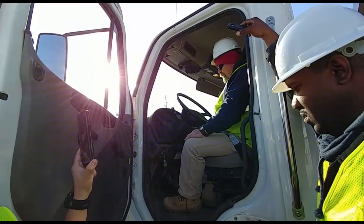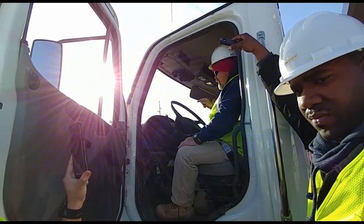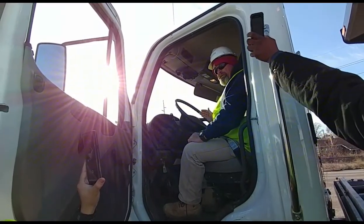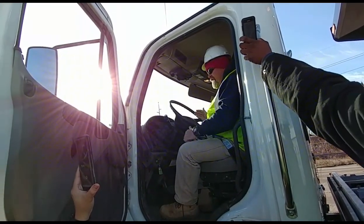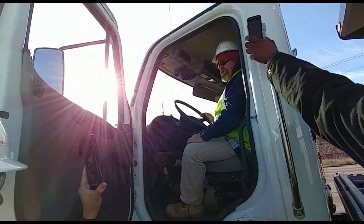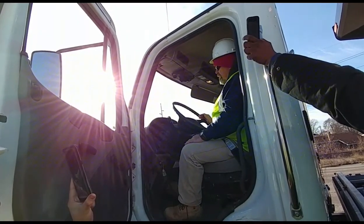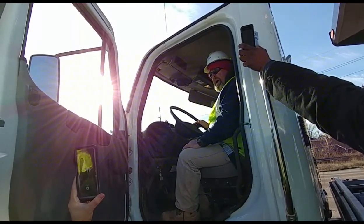The next thing you're going to do is repeatedly fan the brake pedal until the alarms come on. Now, you must give him air pressure. You let that truck build up to governor cutout, which is 120 to 140. Okay? Can't lose more than 4 PSI in 60 seconds. The next one is you fan it down until you see and or hear an alarm, which should be 60 PSI. Once again, get the verbiage that he wants. We've got that now. Alright?